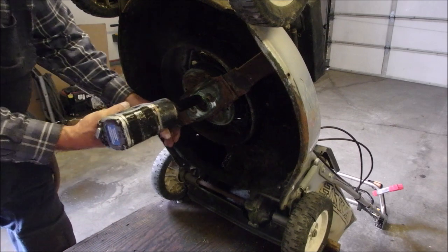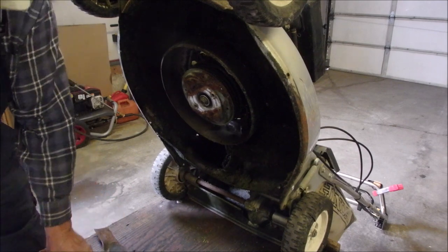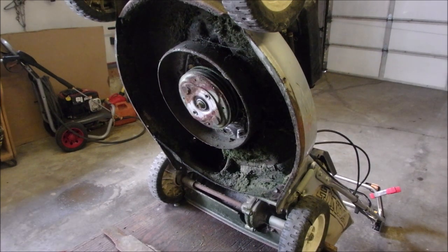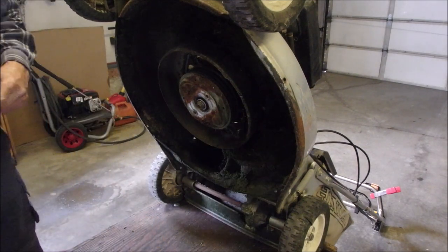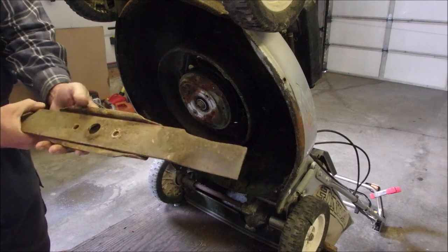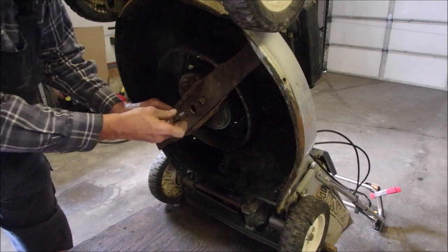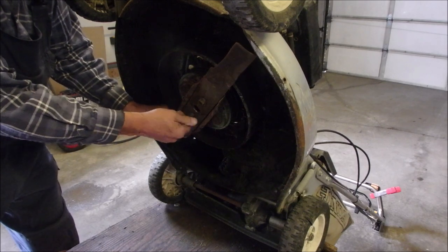Why is that blade flopping? Might have to go look at an old video. That's what I'll do. I got it. So don't mind me, I had to go on YouTube and I went to Bruce's shop and I found a video that shows how this goes together. This plate obviously doesn't go here, it goes here to close up the space between said blade and clutch. Cool, huh? Now we're gonna take this all apart again and sharpen it and all that stuff. But we don't want that ungodly rattle.